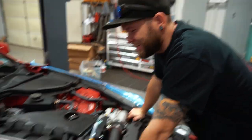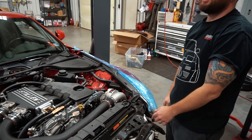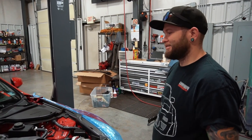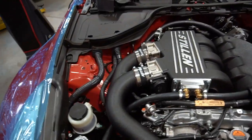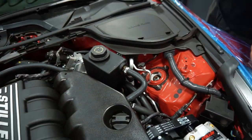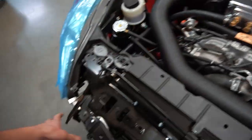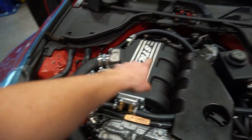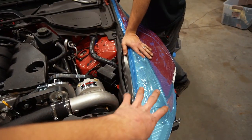What we got going on, Dame? She's done. We've got the Stillen supercharger installed on this bad boy. The only thing we're waiting on is the tune — the base map for this thing. Then we can run her and see what she does on the dyno. We've bled the system, got the pump circulating the intercooler system, all the vacuum lines, coolant lines and all that stuff. We just popped the cover on there to see how it looked because we're going to take it off, make sure none of the injectors or anything else is leaking. Left the bumper off so we can check all the lines and make sure none of that's leaking. But for the most part, we're there.